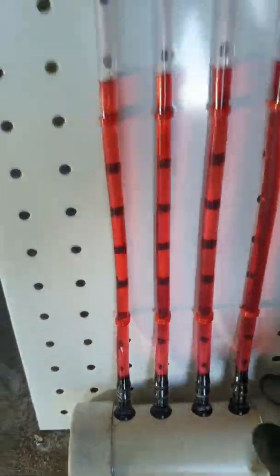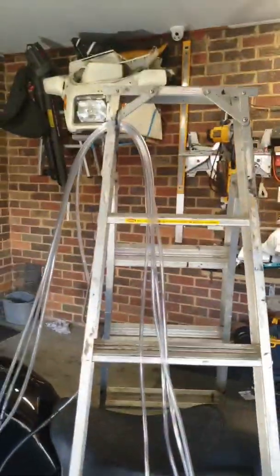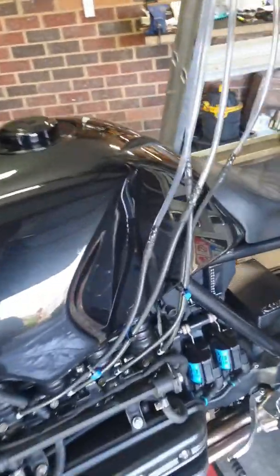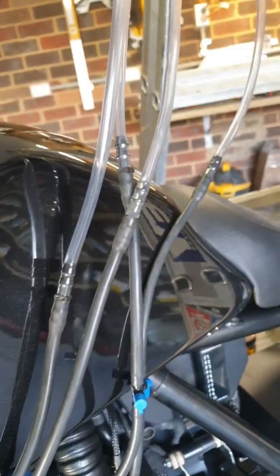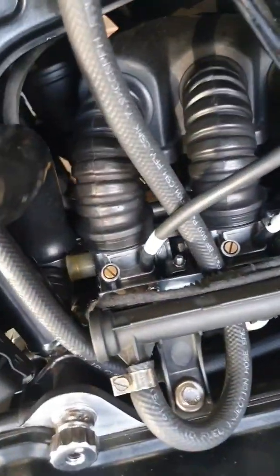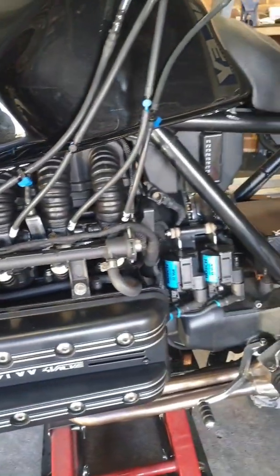It's pretty simple — you just put your four inlets in and tie them up. I've done a long length of hose, as you can see. It uses a little joiner that I also got from the hardware shop, and I've gone down to 4mm hose, which is a perfect fit onto the throttle bodies. I put an inline filter in to start with, because of that problem I was having with throttle body 1 sucking all the fluid out.